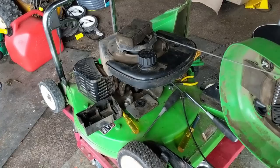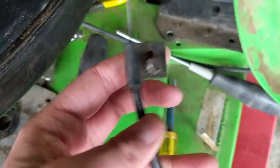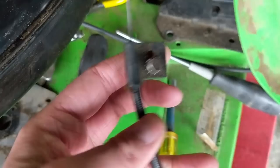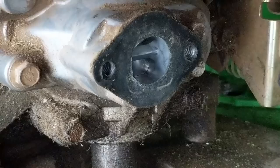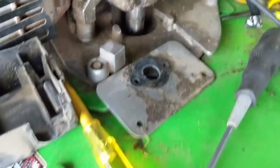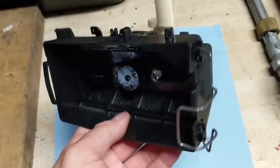I've removed the carburetor — it's quite simple. You pop off a little tab on the air box, remove the air filter, and then you have access to your two Phillips head screws — they're a number three Phillips. Simply remove your throttle cable with a 5/16ths socket and then undo the two Phillips screws and pull your carburetor off. There are a couple of gaskets in there: our inner intake gasket stuck to the engine, and over here we have a little air dam plate and then another gasket in front of that.